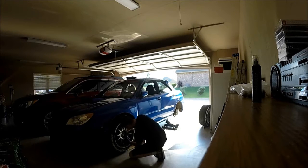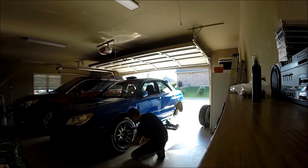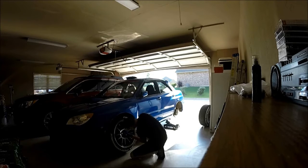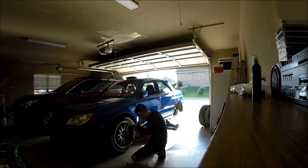I had very little clearance and that cardboard was getting in the way — turns out it was taped to the ground. Depending on how you jack up your car it's going to be at an angle, so when you put the wheel on it won't be fully flush with the hub; it'll be angled a little bit based on gravity. I take a lug and usually start with the top thread, get it started, then push the wheel in a little bit and do one of the bottom ones, then do a star pattern putting the lugs on.